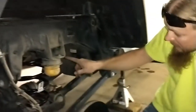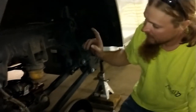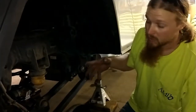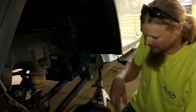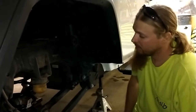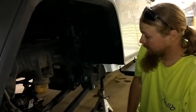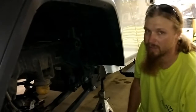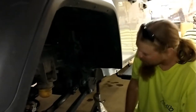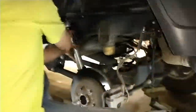I did figure out the other side had 438s before. This one had 439s. Now I've got 450 and 451. What the actual spring compression rate is, I don't know. Manufacturers aren't typically as open about that kind of thing, but if you can find it, cool. I would be curious to know. You can find it now on some of the older XJ and TJ springs. Whether it's out for the JT, I don't know. We've still got to get the other side in, then we'll start putting the shocks back in. But let's show you what we're doing over here.